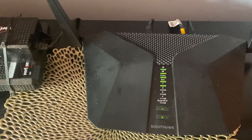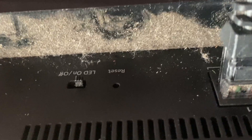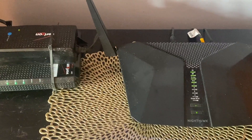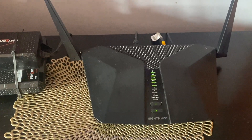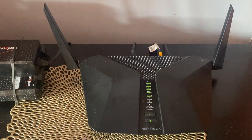I did a factory reset on the router. On the back of the router, you can see the reset button among all the dust there. Using a paper clip, I pressed it in and it resets the settings on the router. I then removed the plug from the outlet on the modem, disconnected the router, and with that cable still out of the router, reset both of them.